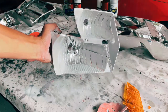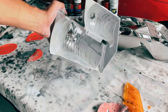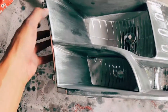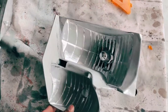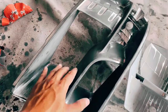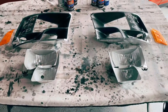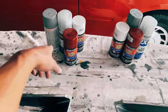You want to get most of the shiny chrome off — it is messy and I'd recommend wearing a mask. For the marker you don't have to do 60 grit, just 180 to get it smooth so the paint can stick. The housing's all sanded down. I got two different outcomes — one is a light grayish and the other came out dark, but that's totally fine. I decided to just keep that section white. Now I need to wipe off all the dust, then it's ready for primer.